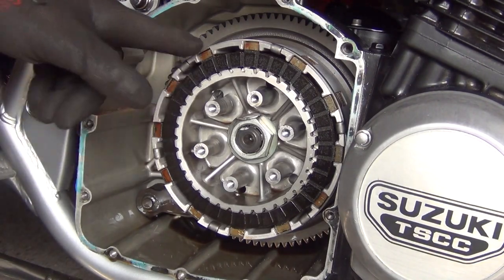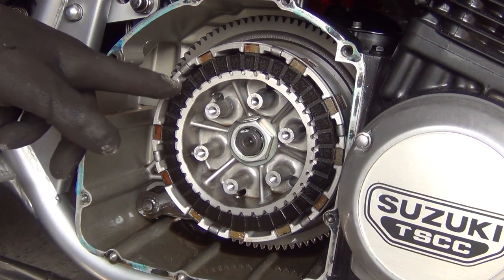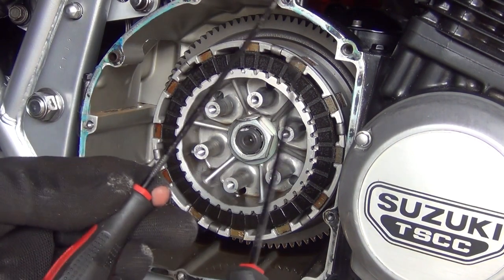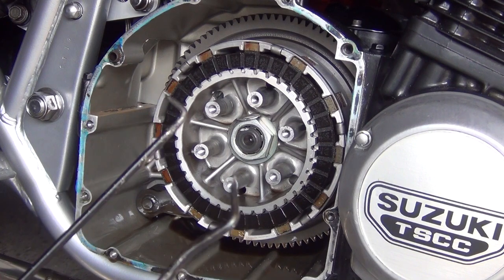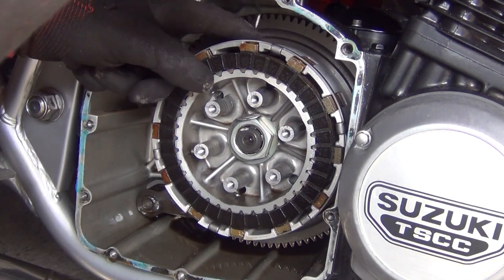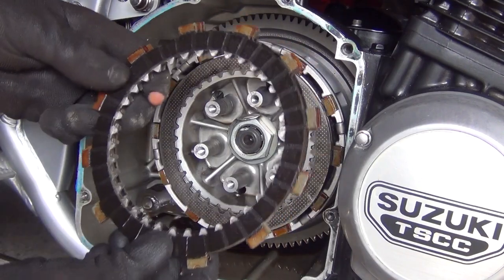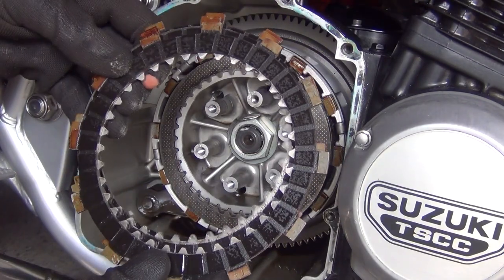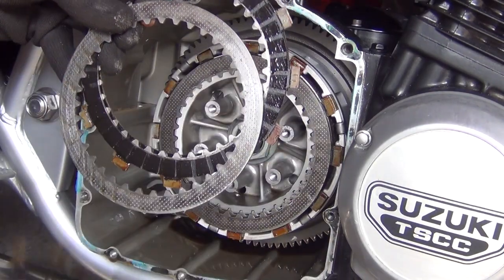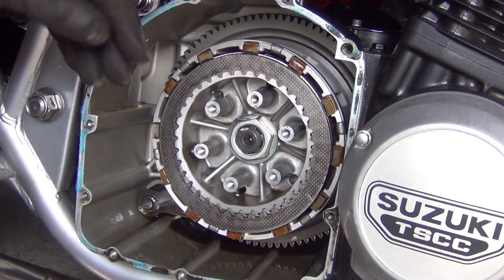You can remove all your plates. This is going to be a combination of friction plates with steels, and all of that stuff has to come off. The removal of those can be a bit of a pain, especially once you've removed the first few. I recommend using those picks — that will allow you to grab them nicely. Arrange them in order so you know how to put them back: first was the friction plate facing outwards, then a steel plate, then friction, then steel, then friction.